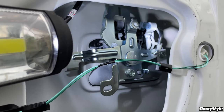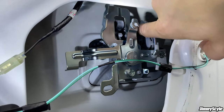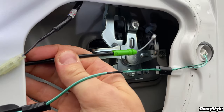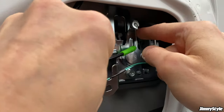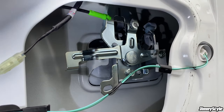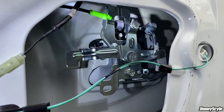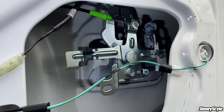Start to connect this arm in the corner — pop it in there and slide down this plastic latch to lock it in place. Now we need to fish out the cable, hook it in there, lift it up, and then this green piece clips in up there. Give it a little test — it all seems to be working nicely. Test it on the outer handle — it all seems to be moving. Now all we need to do is tighten up that 10mm bolt. Not too tight, and that's it — job's a good one.